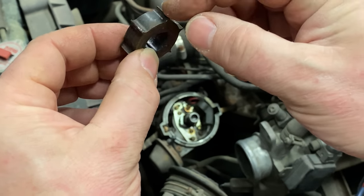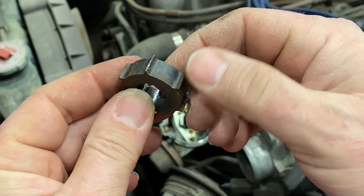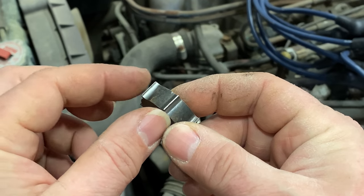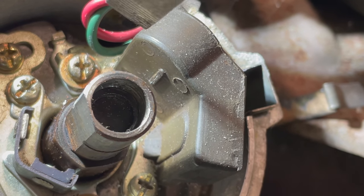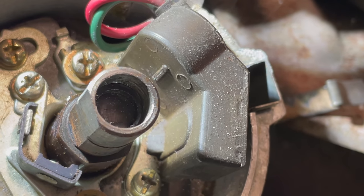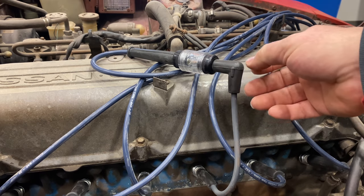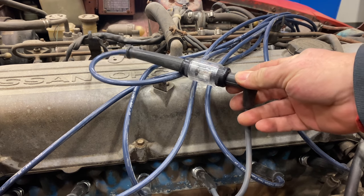Each of these edges on the reluctor wheel, as it passes the sensor, triggers the spark. I'm going to take this over to the wire wheel and freshen up each of the edges — being very light so I don't change the gap. I've cleaned up all the edges and they're now nice and clean. Looking at the detector for the ignition module, there's a little strip at the edge that gets triggered by that wheel — you can see there were flakes of metal stuck to it. Now I can see it all cleaned up. I'll put it back together and retest. With the spark tester hooked back up to cylinder three, which we haven't seen any spark on yet, I turn the lights off and crank it. We have a good, consistent spark there now.